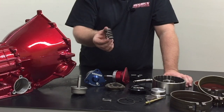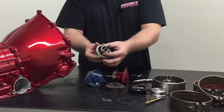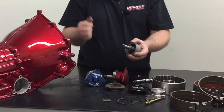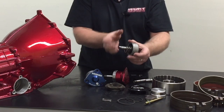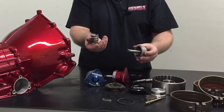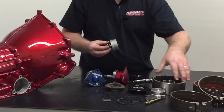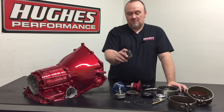The last component in the system is the return spring — pretty self-explanatory once you see how the system works. It sits inside the piston and the other side of the spring seats against the step in the case. When you move the shifter from low gear to high gear you need the servo to come off so the band releases from around the direct drum — that's what this return spring does. It physically pushes the piston off inside the servo bore so that low gear comes off by releasing the band around the drum. There are different rates and calibrations on these springs.